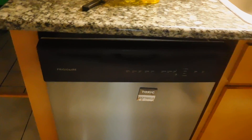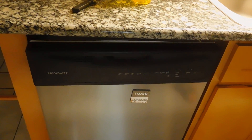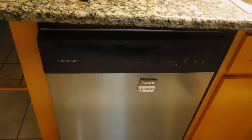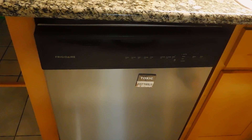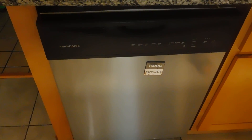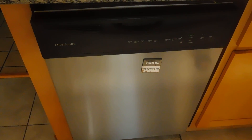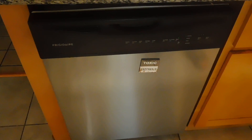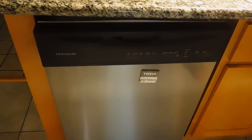The good thing is nowadays troubleshooting is more like a computer tech problem than a blue-collar problem because of the nature of appliances. Finished. The small pause — five seconds. Wash heat. So we're at step five. Wash heat: the wash motor and heater are activated. This test runs for 75 seconds. So 75 seconds, starting at the 45-second mark. About the 22 minute 30 mark.